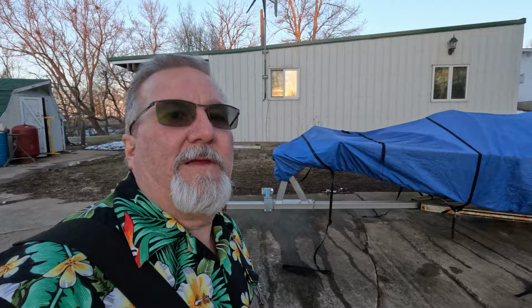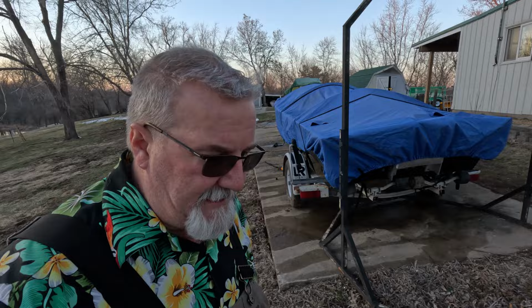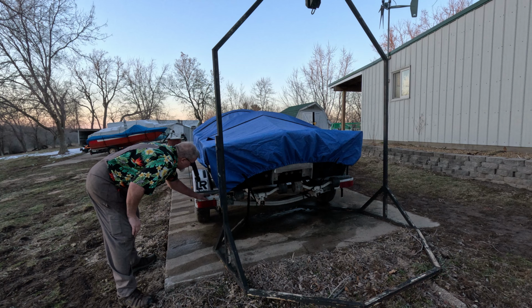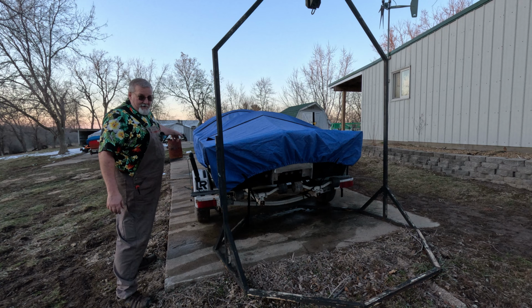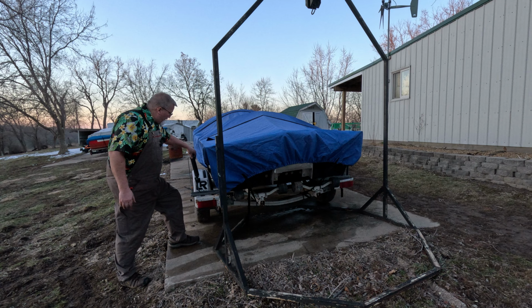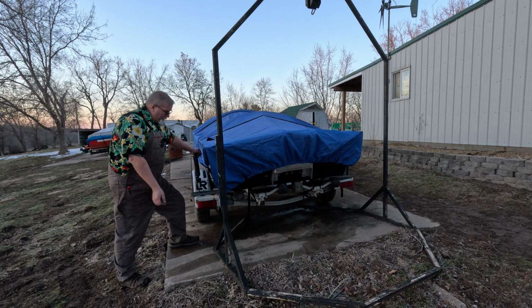All right, all we got left to do here now is work on the butt end of this thing. So we'll take a quick look and I'll give you some ideas. We're gonna back this up toward the shop because we're gonna have to do some welding and some other stuff of that nature. I know we're getting low light here, but I wanna take this tail light, which is bolted on here, off and straighten it out, clean it up, paint it. And these things here that are just a nasty mess, I'm gonna take the leftover old tongue and weld that onto the side of here, get rid of all this mounting hardware, and have it come up. Then I can weld these, cut this off, and weld it right to my piece. So I'll have more of a rigid guidepost. That way, when I'm loading it up in a river or a high wind, this is gonna be solid, I can just run it in there and wham, bam, she's loaded like a man.